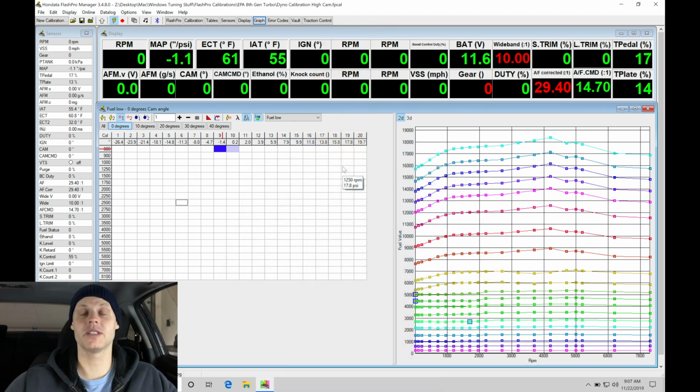Welcome back to our live training session here with our turbocharged 8th gen Civic Si. In the last video, we mapped out our full throttle area of operation for our high cam. We've also set up the VTEC engagement point, and we have essentially tuned everything up to this point in the video. And I wanted to include doing a boost control tutorial, but unfortunately, the returnless fuel system on this car just simply isn't going to provide enough fuel with the 1000cc injectors and the upgraded fuel pump.